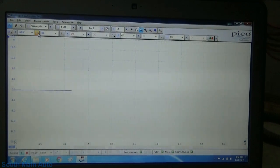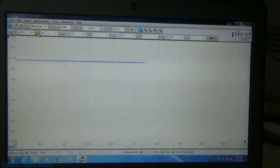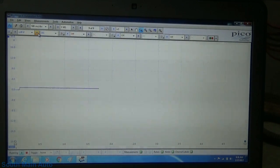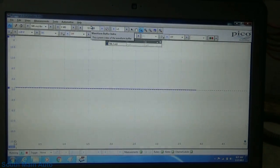Just for the heck of it, I went ahead and unplugged it so you can see: the power side is still at 11 volts and the signal return side is at zero. So there is no bias voltage being set down that signal return side. Once it's plugged back in, it just floats just above zero — roughly 746 millivolts. That must be the low side.